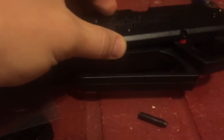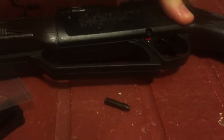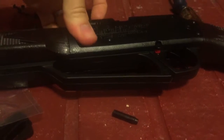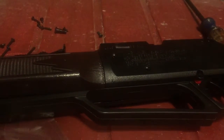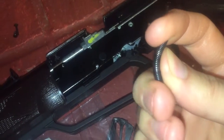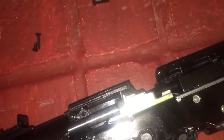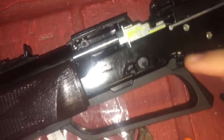With it like that, I can now put this piece on — this is not the easiest to do one-handed. Let me get the screws in here; there are six screws on each side, keep track of where each one goes. Almost forgot — there's a piece, this little spring, this little springy piece of metal. It drops down right there and that's what holds the pump up, so make sure you drop that in.